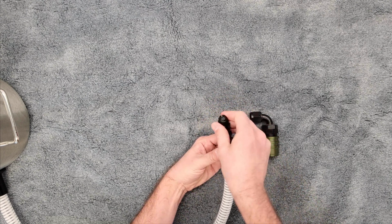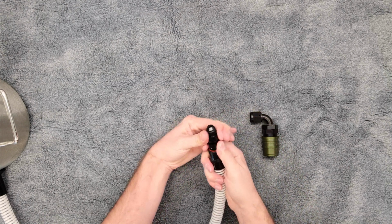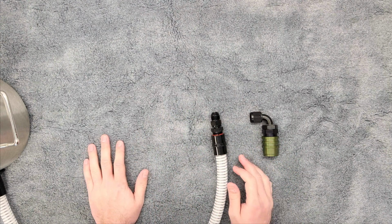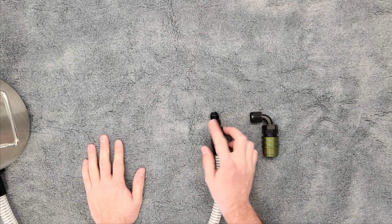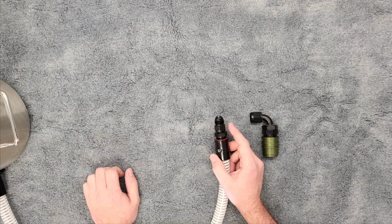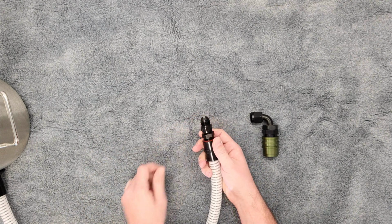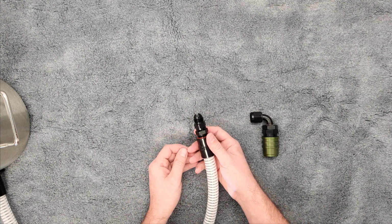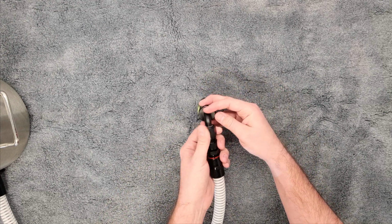And as I said before, with the gauge and the valve assembly on top of the lid, this does not have to be super tight. Honestly, that's enough. If you have to put a wrench on it, fine. These are anodized fittings. Putting a wrench on them, you're likely to scratch them up. So you can put some masking tape around the outside if you want. They also sell specific AN wrenches to prevent that. But at most, we're going an 1/8 inch past this point we're at with tooling. Again, it's not necessary. I don't suggest it. It's just wear and tear on the fittings. So that's going to thread in first. Then our series adapter is going to go on next.